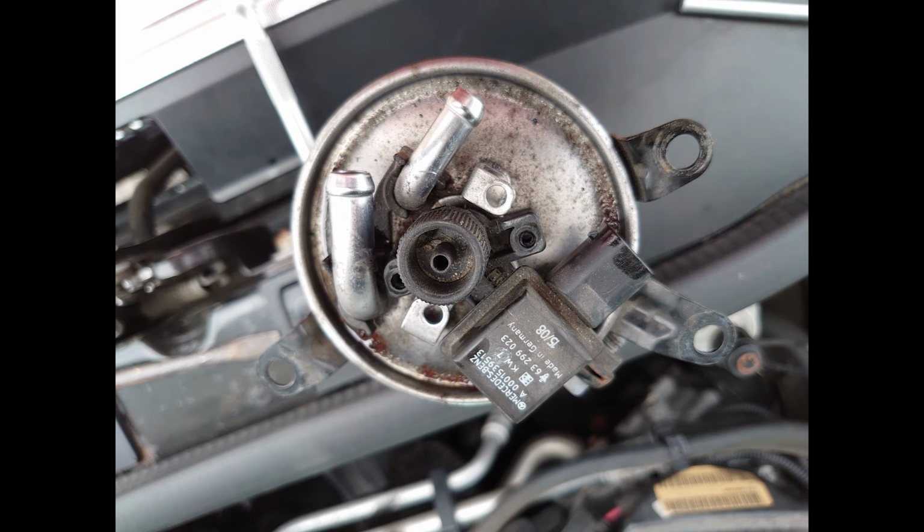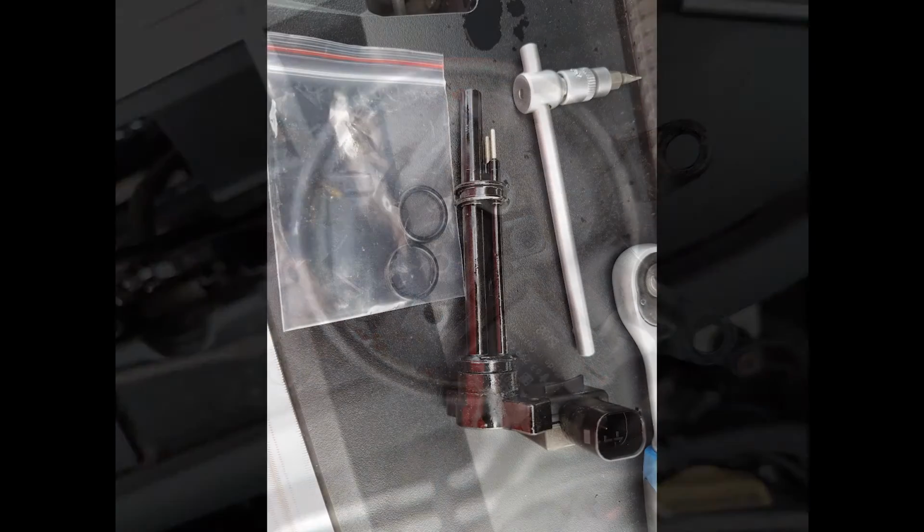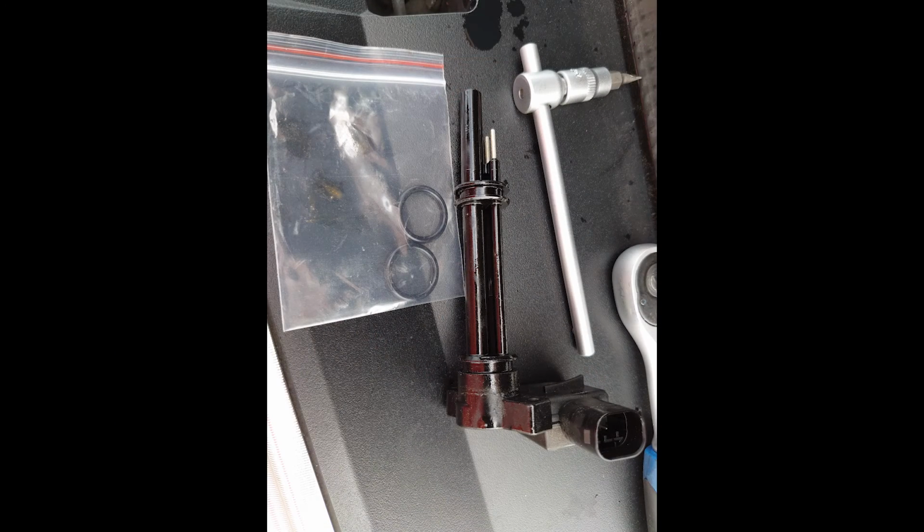Now twist the sensor unit carefully. You can see here how it has 2 wings that hook under those 2 small screw hole brackets. You twist until they clear the little plates, and then pull the sensor unit out. It might be very tight, so take it easy.